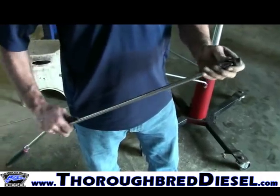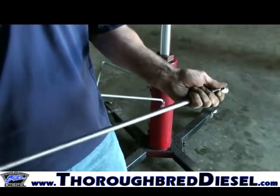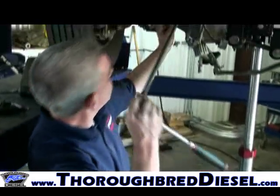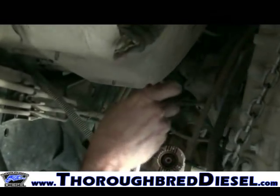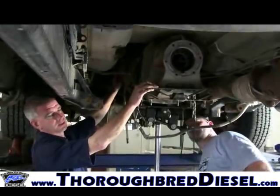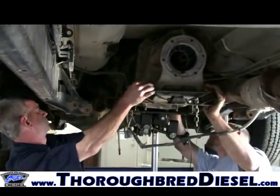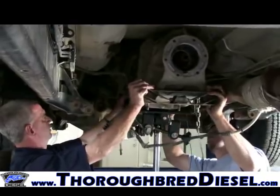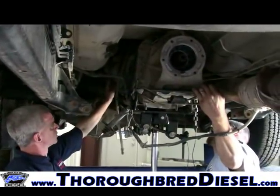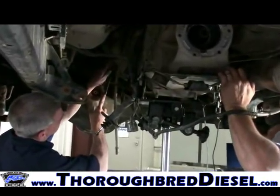Once you've hand-loosened all your bell housing bolts, a 14mm metric swivel head socket will make your life 100% easier — you can use a regular 14mm with a universal and a long extension bar to make you twice as fast getting to the bell housing bolts. We've got all bell housing bolts out so now we're going to drop the transmission. Everything on the transmission jack is secured. First, wiggle it back and forth to get it loose and get a gap between the bell housing and the engine, then use a pry bar very lightly just to get it started back.